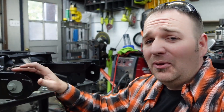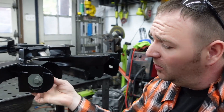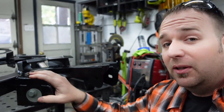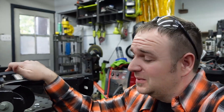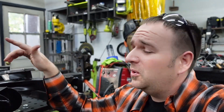That's a wrap on the front subframe. Got everything painted up, I just got to slap it in. Everything turned out pretty good. I also included eccentric washers on the lower control arms — it's going to allow me to have a little bit of alignment, three quarters of an inch in and out, so that'll definitely help getting this thing running straight. I think that was a pretty good idea. Next video, I'm going to test fit this subframe, bolt up all the suspension and see what it looks like. I still have no idea how wide, how low, what it's going to be — definitely going to have to cut some stuff out of the way to get it low, but we'll deal with that later. Thanks for following along with the build, and come check out the next video — have a little more progress.